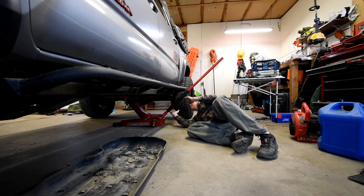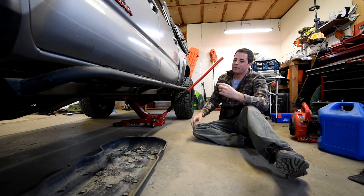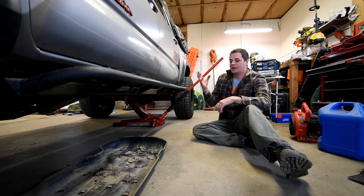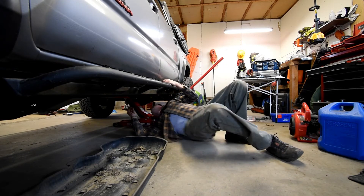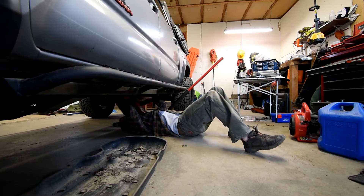I've got it sucked up pretty good. The beveled end with the two bolt holes goes to the front. We're gonna install those bolts in the front first. Once you get it lined up, grab your nuts and fine-tune those holes. This right here is the front — we're going to install the factory-supplied bolts from Mob Town right up in here. I've lined up those bolts in the front and loosely tightened them.